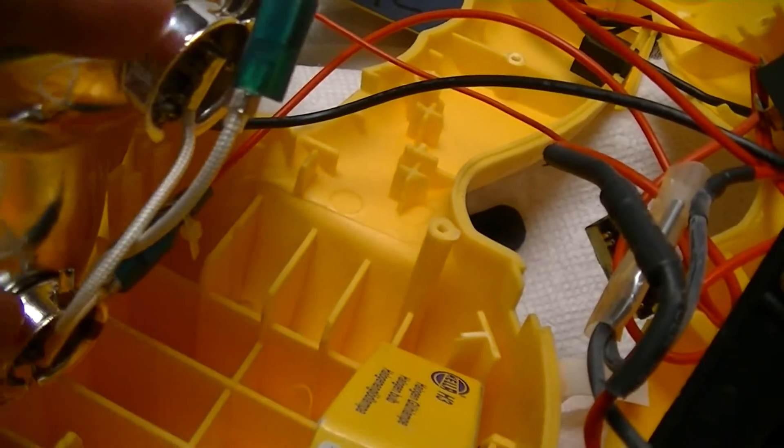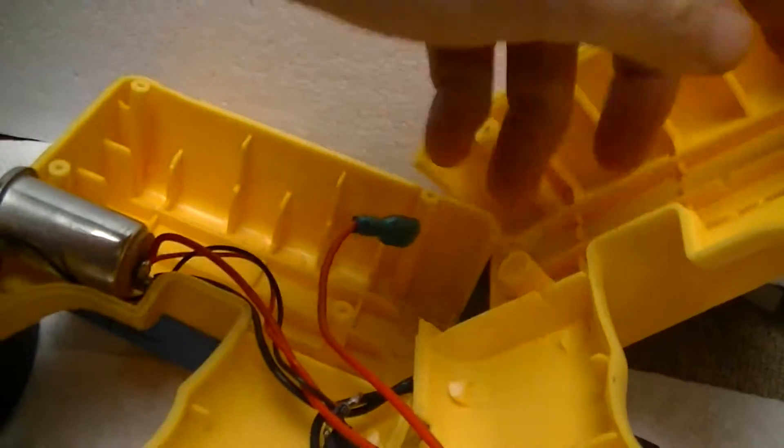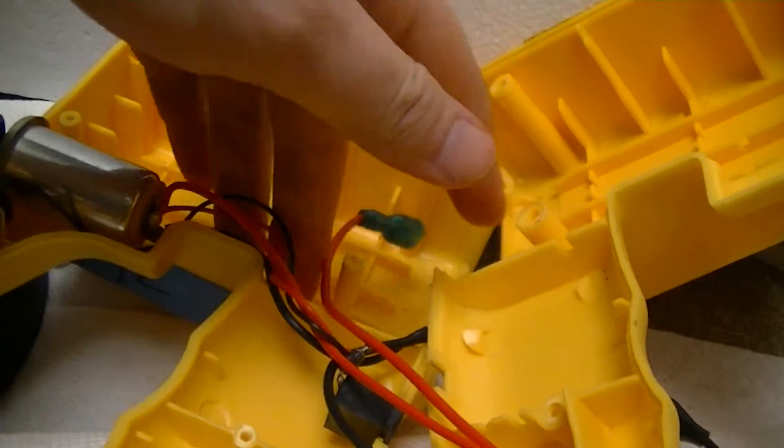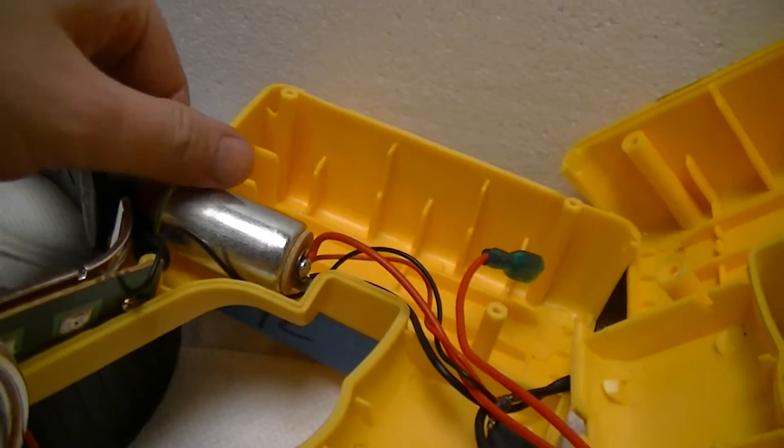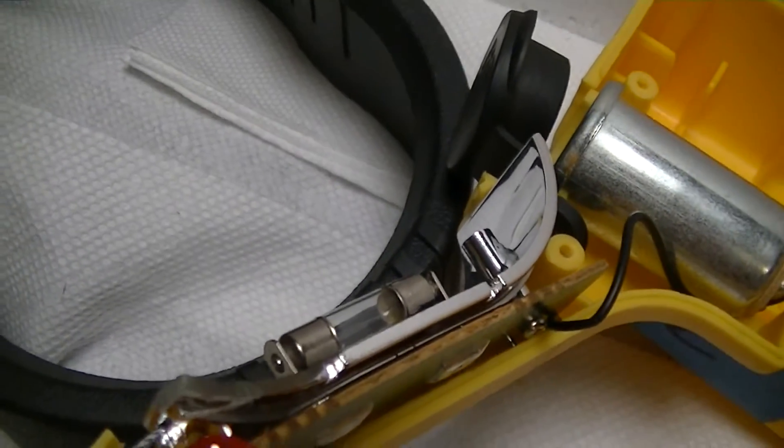These are somewhat higher quality lamps than the generic Chinese ones in these things. It's quite simple inside — there's a little plastic frame whose entire purpose looks like it was intended to keep the battery terminals from possibly shorting against this. The battery is built into the light and you have to disassemble the entire light, but the other battery is in an easily accessible compartment in the handle with a little door. There's also a cigarette lighter socket on the front, and an area light which takes the equivalent of a 3021 festoon lamp, marked as 12 volts, 3.6 watts.